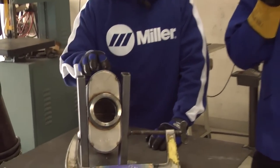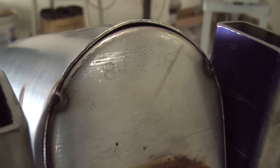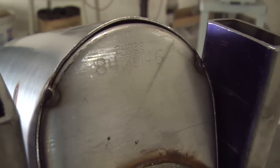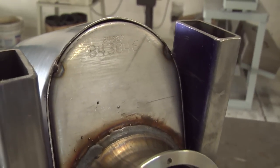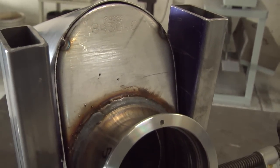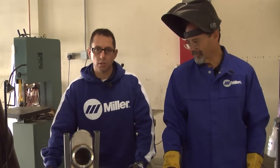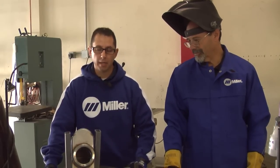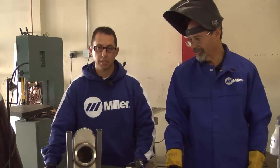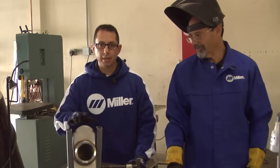Flowmaster uses 409 stainless steel for their exhaust systems. One other alternate could have been a 300 series or austenitic stainless steel. The 400 series is a ferritic stainless steel. The big difference between the two is that in the 400 series the chromium content tends to be a little bit lower, and realistically it's a little more cost effective. Even in production cars most recently they started to shift over more toward the 400 series just to help for corrosion resistance. You still get that in this process.